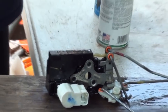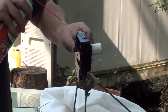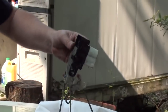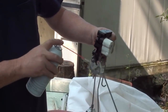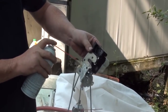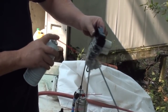I call it heavy-duty silicone lubricant. You can get it at Walmart. I'm going to spray it down with this just to wash the brake cleaner off and make sure it doesn't corrode the plastic. Then I'm going to chase it with white lithium grease spray. I'm just going to grease everything up really well, all the nooks and crannies. I don't feel like taking this thing apart, I'll tell you that.